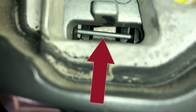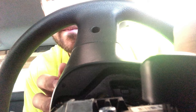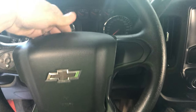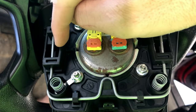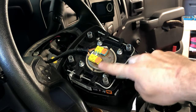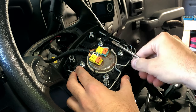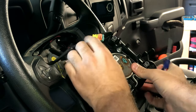You can see it very clearly right there. That bar going across the metal part is what you need to lift out of the way, and then you can pull the front of the airbag off. I'm just using a flathead screwdriver to insert it into the back of the opening, push that bar down, then pull on the front of the airbag. Do the same on the other side — push the bar down and pull on the front of the airbag to release it. Once you get those two clips, you can pull the airbag out of the steering wheel. There are two wires on the backside that you need to disconnect. These are the two bars that you're pushing when you release them from the clips — that's what secures it into the steering wheel. There are two airbag connectors with locking tabs that you need to pry up first, then pry out the connectors, and the airbag is free.